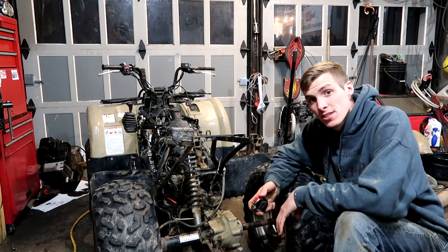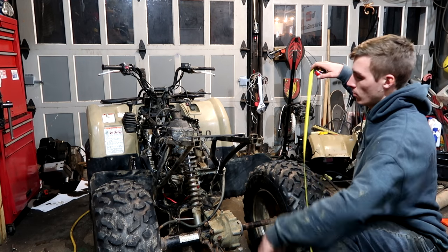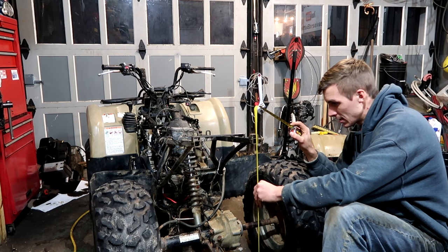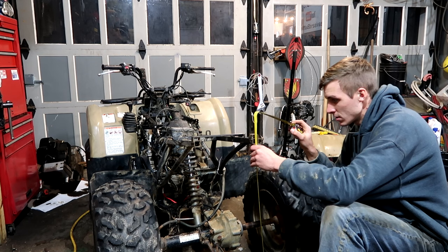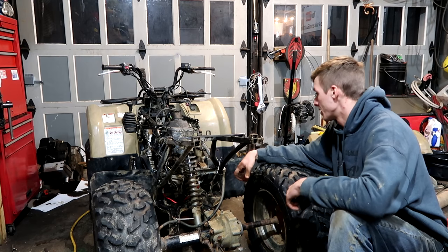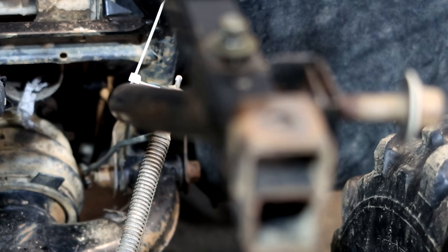I'm not a collision expert — I'm just a kid who went to a two-year school and ended up getting two degrees. I'm not saying that in a braggadocious way, I'm just stating the facts. What I want to know is what are my heights at right now. This one's at exactly thirty and a half inches; this one's at exactly twenty-nine inches and three quarters, measuring from the ground to the bottom of this frame. So that's a difference of three quarters of an inch. I want to see if just bending this will bring it up. Check out how straight this side is compared to this side — it twists right out of the shot.